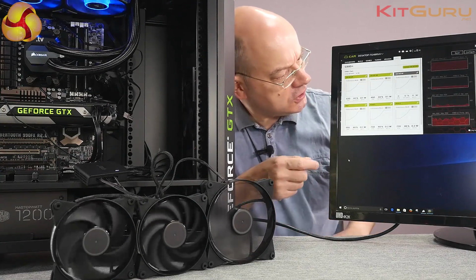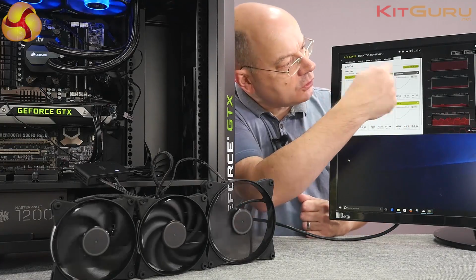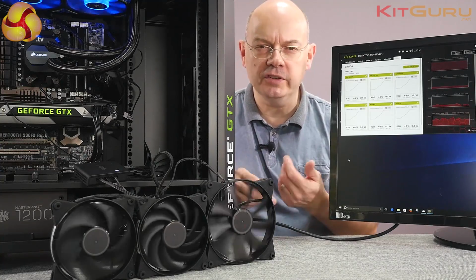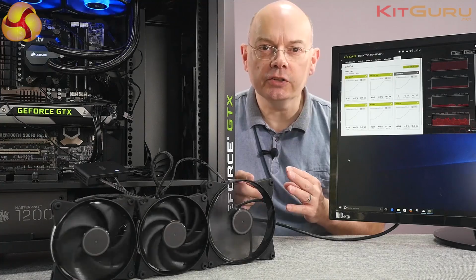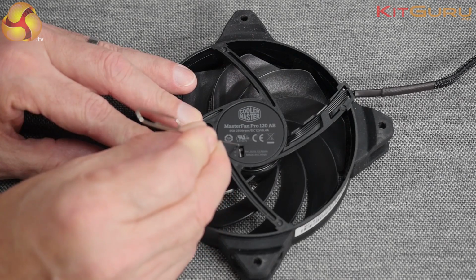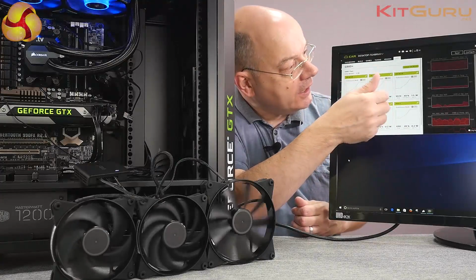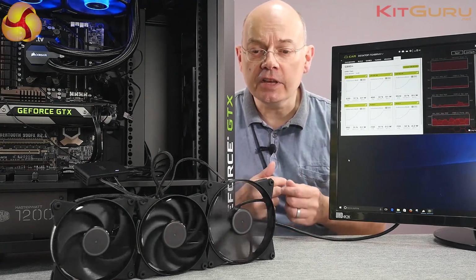So we've got 6 slots. These 3 are the stock 3 fans. These 3 are these 3 fellas here, and we've got 2 120s and one of the 140s, air balance, airflow and air pressure. Just so we've got one of each to make sure it's not one particular fan that's doing something a bit peculiar. And they're all set in performance mode on the little flick switches on the back, and they should be humming away at a fixed flat speed in Grid Plus.